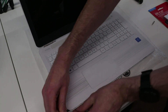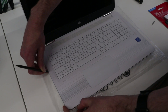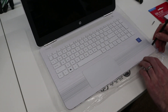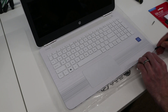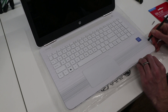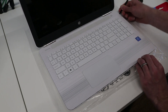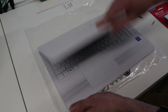So if we run around this here, as we go around we can just hear that clipping to release. The main board and so on are actually attached to the palm rest, so we just need to go in from this side to release the clips and then flip over. By going around here we will release all of those.